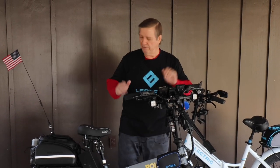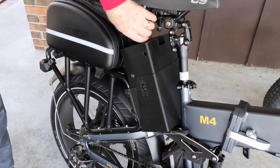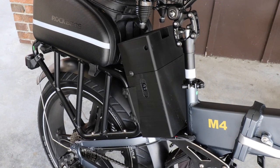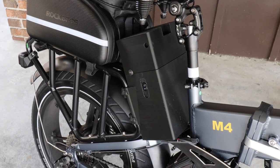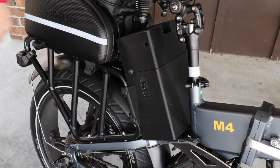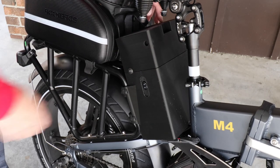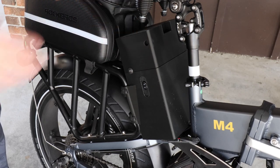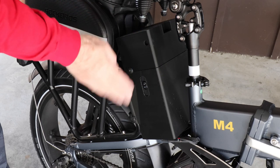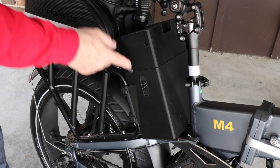The first thing I'll show you is my battery box. If you've been watching my videos, you know I have auxiliary batteries I've made for my bike and I've gone through various stages making different types of auxiliary battery boxes. This is the first one I've made with my 3D printer. Inside it I have my 20 amp-hour battery. The top comes off and the battery comes out. I've got foam insulation to stabilize it so it won't move around and to cushion it against shock. I've also got the on/off key for the auxiliary battery.